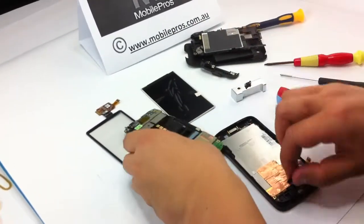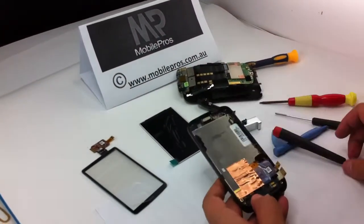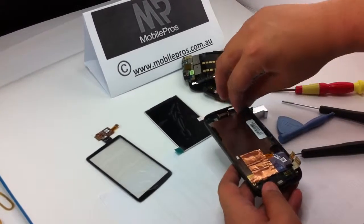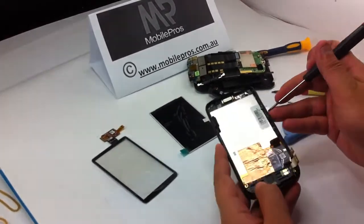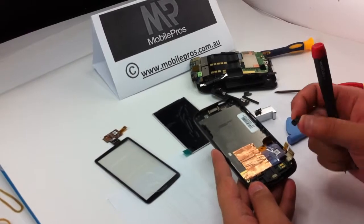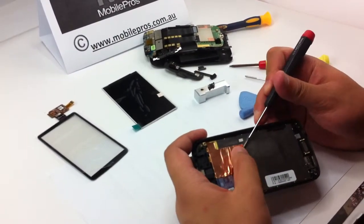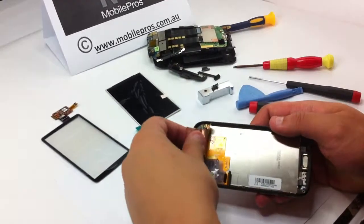So that's it. Now you can see the front LCD, which is this part, some side buttons, and the bottom buttons. Take off the side buttons — the power button first, then the volume button. There is a little rubber piece for the microphone. Locate the copper and peel it off from the LCD. Do it gently and don't damage any cables underneath.